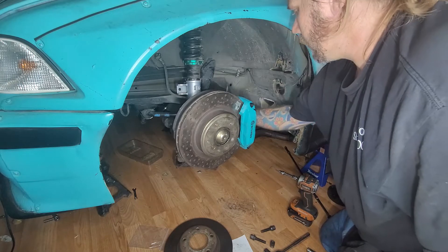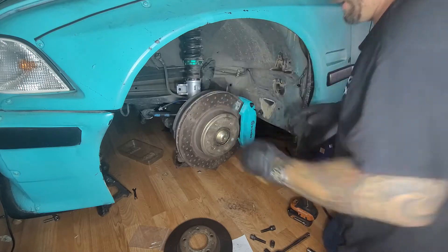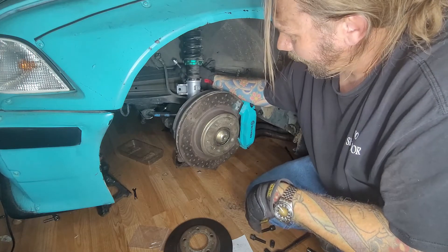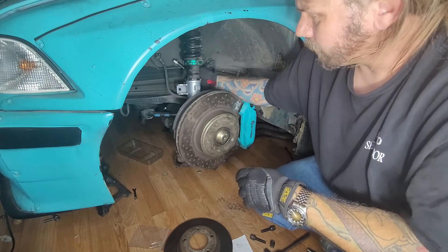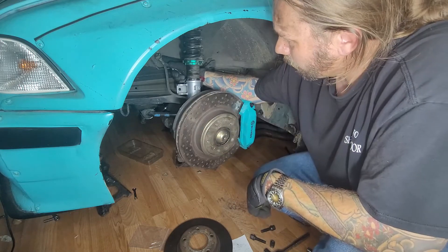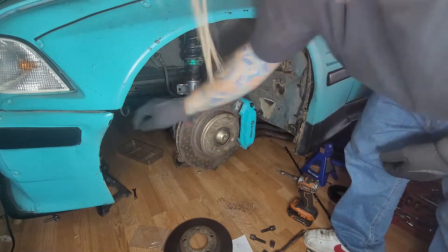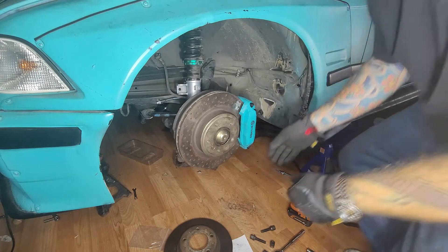From here, we now have the Turner brake lines. You can see they're going to run just shy — these are the E36 Turner brake lines. What I'll probably have to do is, because this is an aftermarket Brembo system, the connection point is on the far side of the caliper rather than the top side, so we're just short by a couple inches. I'll probably disconnect from the back wall and gingerly bend that pipe down a little bit, or look at whether the E46 brake lines are longer.